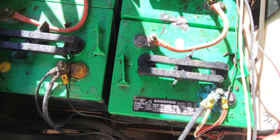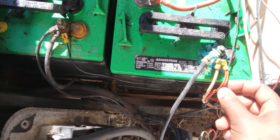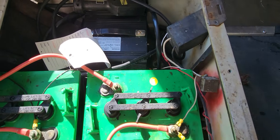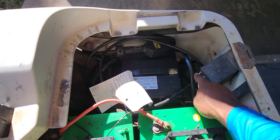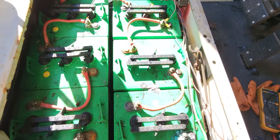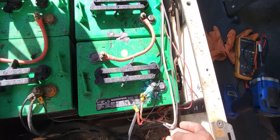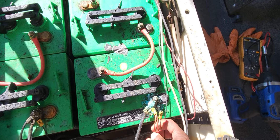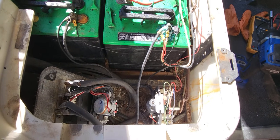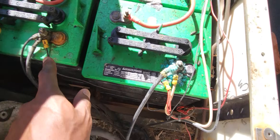When you get over here — boom, look at that — this wire is loose, and that wire is loose, and this one is really getting loose. This could be your problem. If you trace this white wire over here, it goes to the charging plug. This has a proximity sensor in there — if the charger plug is in, it tells the computer not to allow the golf cart to drive. Since this wire from the charging port is broken, chances are that may be all that's wrong with this golf cart. This wire has corroded and broken off.